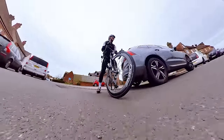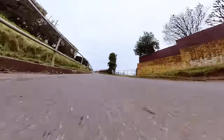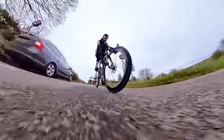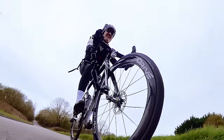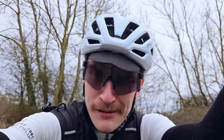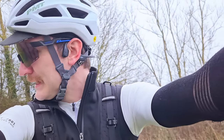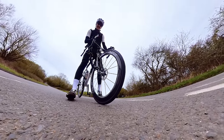So the first hill — a nice, long, fast descent. The first few brake pulls were so weak compared to the resin, but I expected this. I kept checking behind me to make sure the road was clear, and at the bottom I really dragged on the brakes to build heat and get them bedded in. Not crazy impressive — I expected them to heat up and then really bite. But let's give them another run and see if they do any better. First run, I was a bit disappointed. I was giving it welly on the way down, thought I'd given enough to bed the pads in.